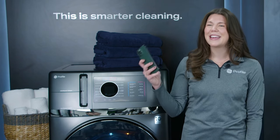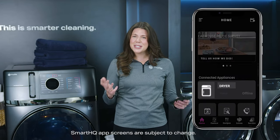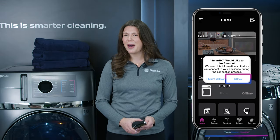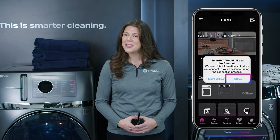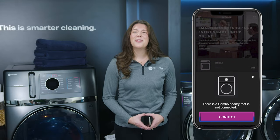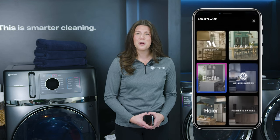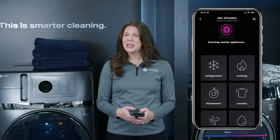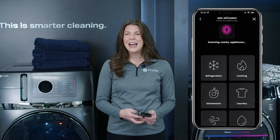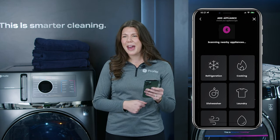Now, let's grab your phone and get started. Access the Smart HQ app. The first time you open the app after installing it, you will be prompted to allow Bluetooth. If your new Combo unit is automatically detected by the Smart HQ app, this prompt appears on the screen and you'll select the Connect button. If you don't see this prompt, you will select the Connect Appliance button and then choose GE Profile for the brand. The next screen will display a list of appliance types and will show scanning nearby appliances, indicating that the app is scanning for a new appliance. Pause here to allow the app time to scan.